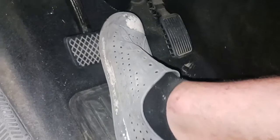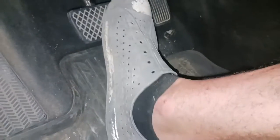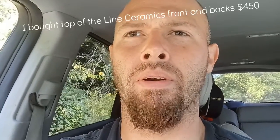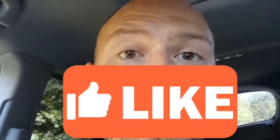The car is running — look, my foot is all the way to the freaking floor. Don't forget to pump the brakes back so your calipers can start to squeeze and go back into place, because all that fluid you pushed back up the line has to come back down. I got pressure now. Moment of truth going downhill — I slowed down. Fixed! Hey, that is quite better. You get what you pay for. Like and subscribe — I put a lot of effort and time into these videos.